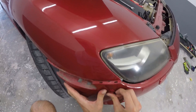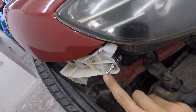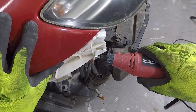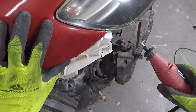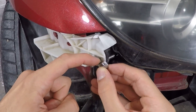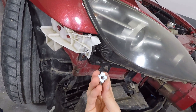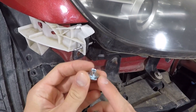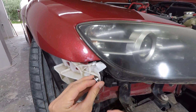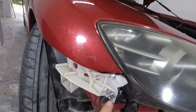Time to position the bumper and see if it clicks in place — but something is interfering in the back. After inspecting, I found that a white plastic piece under the rod sticks out and prevents the rod ball from hooking inside the button. I take out the rod and use my Dremel tool to cut that piece of plastic away. I also noticed the front nut is preventing the rod from going further in to make the bumper more flush with the body, so I replaced it with a special wood nut and cut away the metal blades to make it flat. To accommodate the new nut I made the hole a little bigger, and now everything is installed again.